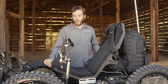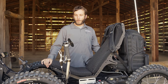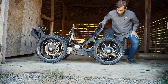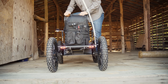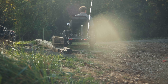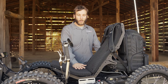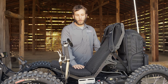The most significant change on the Coyote that we've made is in the suspension. The suspension is already amazing on this machine — full air suspension, fully independent, lots of travel, and an incredibly smooth ride even over super rough terrain. We've gone even further and added an extra one inch of wheel travel all the way around so it can soak up bigger bumps before bottoming out. It's also got an additional one inch of ground clearance to get over bigger rocks, roots, and stumps, and that's also raised the seat height by about an inch — making it a lot easier to get in and out whether you're transferring from a wheelchair or just sitting down.